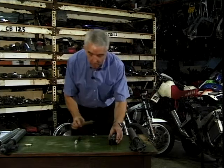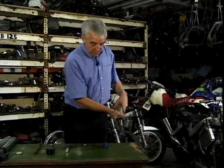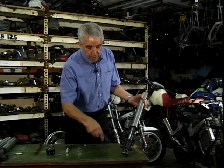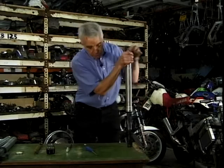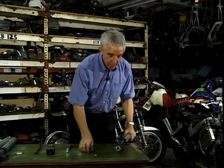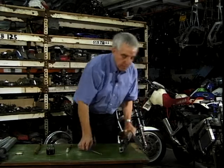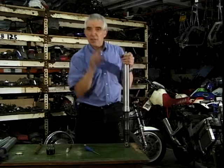But let's put that aside. What do we mean in the real world? Here we have a fork leg. This one is quite sophisticated because you've got your adjustments for your compression damping down the bottom and your rebound damping at the top. On this one, I've actually slackened both screws well off. Now if I push that down — just like that little demo — see how easy it goes down and it also flies back. If I now click this up — it's got little clickers on there, you can probably hear those going around. It's important to count the clicks when you are messing around with that. I'm going to bang that one right in. Look at that — you can even hear the table creaking. That's really stiffened that up. So that's your compression damping.